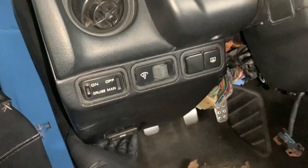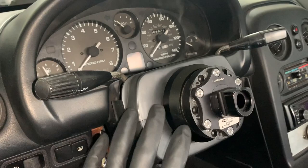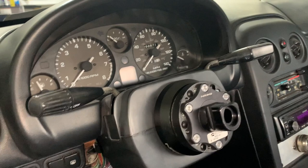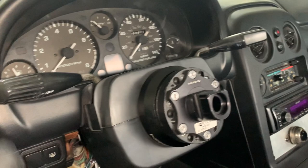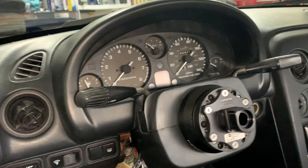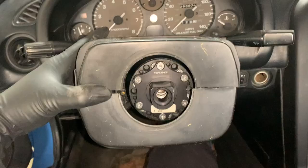Might as well just go ahead and pop the hood as well. It's definitely a lot easier if you have a quick release because you don't have a steering wheel to navigate around. Basically what you're going to do — you need to remove the hood so you can pop the speedometer gauge cluster out. To get the hood off you have to take off these panels here — a couple screws here and here, and then a couple more screws back here, and then this should all just kind of pop out. Be very careful, take your time, don't rush things.